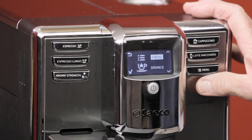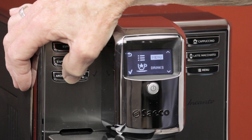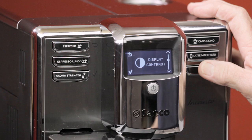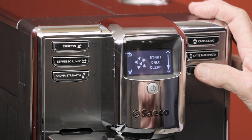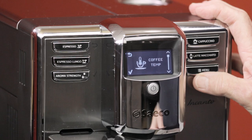I want to show you the menu. You can get into several things within it. Bear in mind it's not a touch screen — you have to use the buttons that correspond with each option. Options include: coffee temperature, standby from 15 minutes up to 180, display contrast, water hardness — use the test strip to set the machine accordingly so it knows how often to descale — water filter, and descale. Push the descale button only when you're ready because you can't get out of it. You can also reset back to Saeco's recommended factory settings.